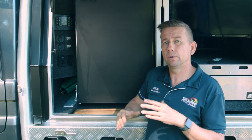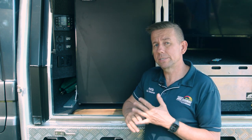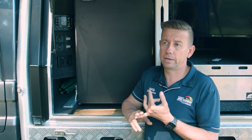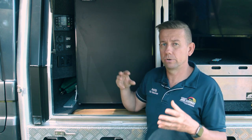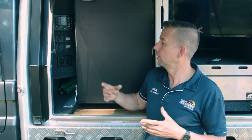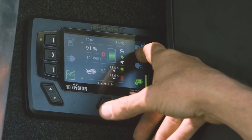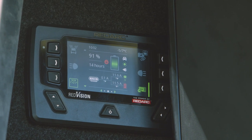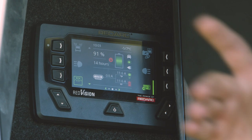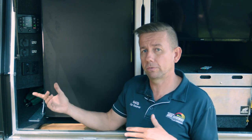Each channel has been programmed to do whatever we wanted it to do and with whatever symbol we wanted. When you wire these things up you can put different inputs to it — we've run an ignition input, a reverse input, a high beam input — and that then allows me to control each channel to turn on or off whenever another circuit is activated. For example, down here is my battery link button — I've used that to control the BCDCs we spoke about. At the moment there's a padlock on there because the ignition isn't turned on. We've set that channel to turn on the BCDCs when the ignition is on and when we activate the soft key — giving us full control.